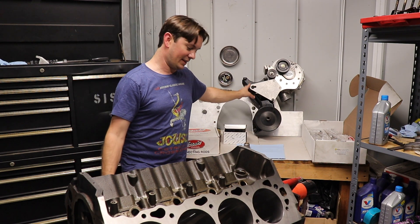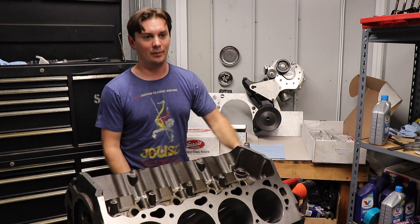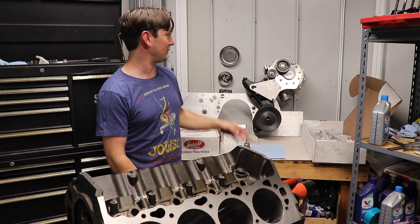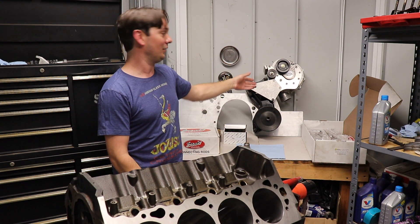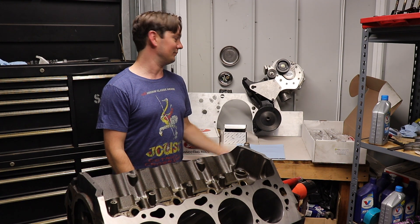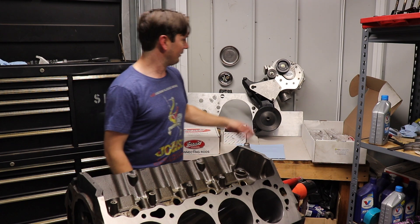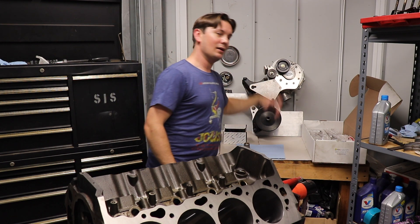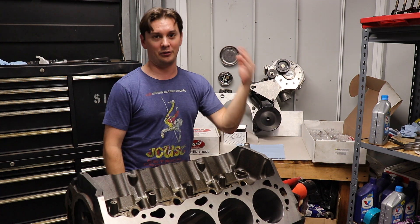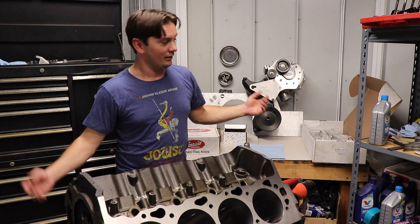The important thing is the Pro Charger — this setup holds it and mounts it perfectly. I currently have it on my motor plate, because I'm going to tie the motor plate into the roll cage instead of using motor mounts. I'm also using a mid plate, and it's great because I can hang everything off there. As far as the re-clocking issue — instead of the outlet coming out here, it comes out over here, which is exactly what I wanted. I'm going to use an intercooler, so I needed it to go forward through my radiator core support, into the intercooler, back out the other side, and up into the intake.